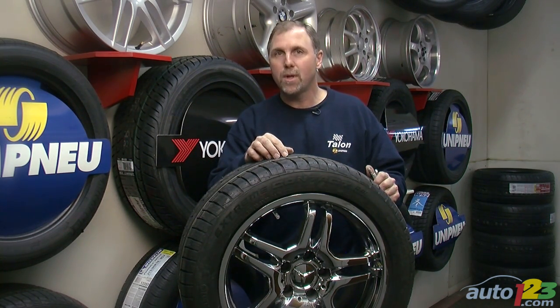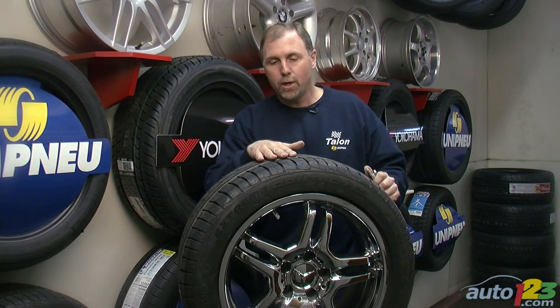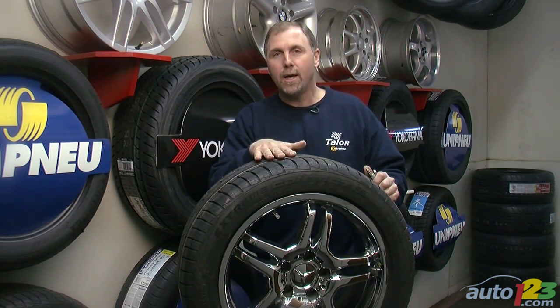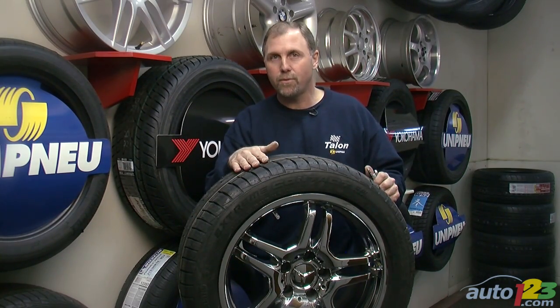when their tires have gone out of balance. Additionally, tires will come out of balance over time because as well manufactured as tires are today, typically there'll be a small higher spot in the tread, and that part of the tread will begin to wear more quickly than the rest of the tire, and the tire will gradually come out of balance.